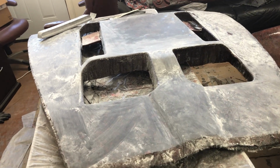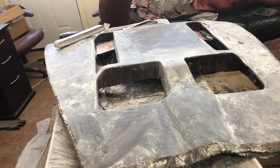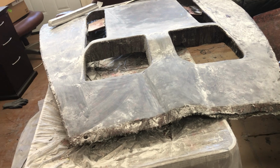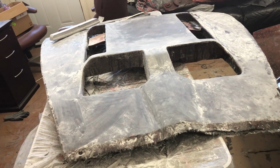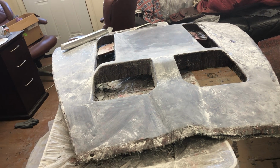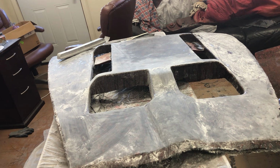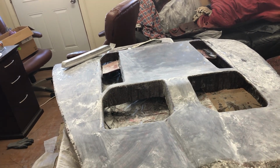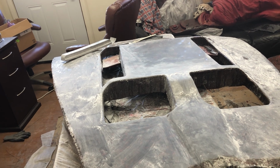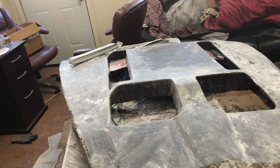And so the end result didn't exist, as in no mold existed. So we had no choice but to skin it. And we used the chopped carbon fiber. Now the chopped carbon fiber, when you put it on, ends up with a very rough surface because you just can't get that chopped carbon fiber to lay flat. So what you do is you just go ahead, put it on, put some epoxy, and then what we've been doing is just adding more layers of epoxy as we go on.